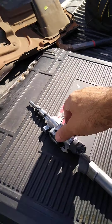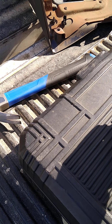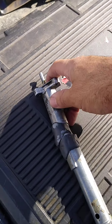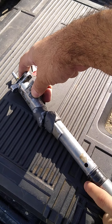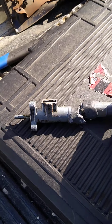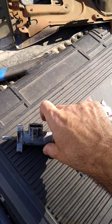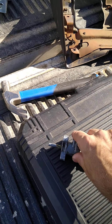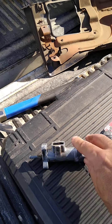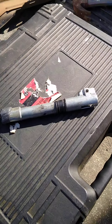There's some internal stuff that has to do with the locking — it doesn't really matter what any of that does. What you need to know is it went together like this, and where the brake is right there. You'll see it when you're underneath — you'll be able to move this when you move the shifter. When you grab it from underneath, you can move it through the gears, but you can't do it with the shifter. That's going to be your problem.